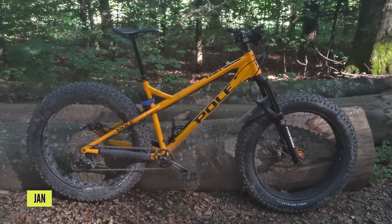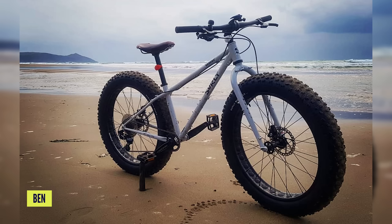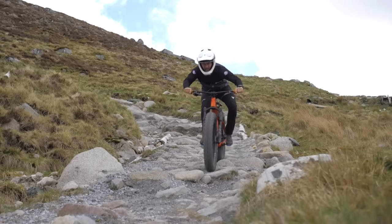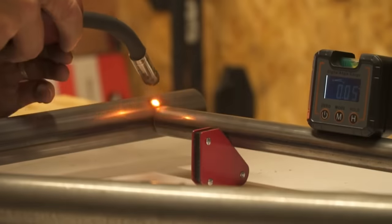Possible options: Pole used to do a fat bike — not sure if they still do — but they definitely do a plus hardtail which is extremely slack, so that's one option. Other options like Surly or Salsa are all too steep. Surly does have a 44mm head tube, so you could fit an angle set and potentially get it down to about 66 degrees. If you're not running a suspension fork, do you really want 64 degrees? That is very slack. I think slacking an existing bike with an angle set to around 66 is a good compromise. But if you want to buy one outright, you might want to consider a custom steel frame built to the geometry you want — it might not be as expensive as you think with a local frame builder.